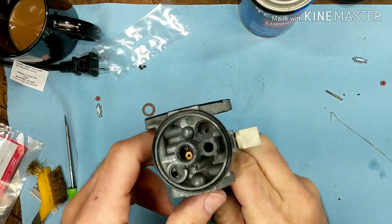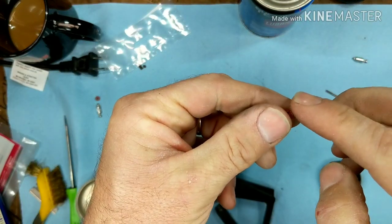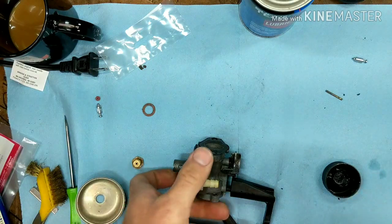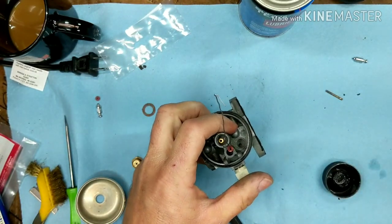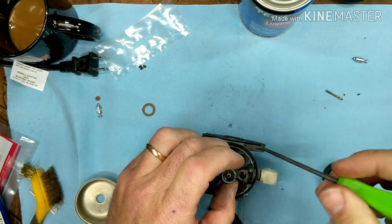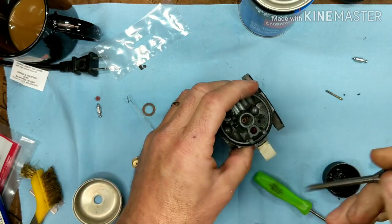Let's get it installed. I got it cleaned up and ready to go. I'm going to take the seat and put a little bit of seal glide on it. I use this stuff for all rubber whenever I'm using any rubber fittings or O-rings, just to help it slide in nice without any binding. I'm just going to put that all over the seal. I'm going to take a wire — it helps guide it in straight. The ribs go in first; put it down the hole and kind of wiggle it and push it down with another tool. The wire keeps it straight so it doesn't get twisted. I just barely tapped it. Then the wire comes out and I use a punch that fits right in there perfectly, and I push it down into place.